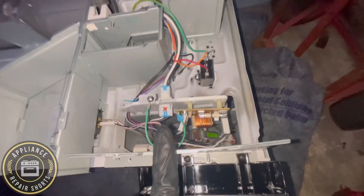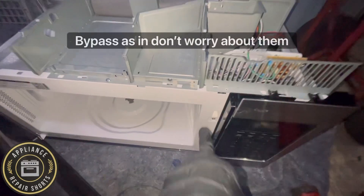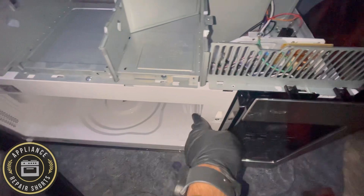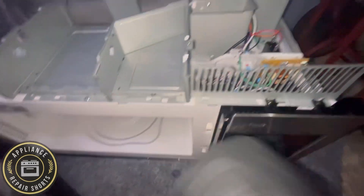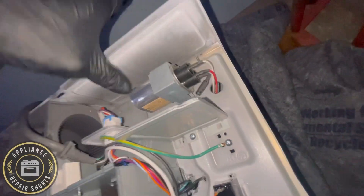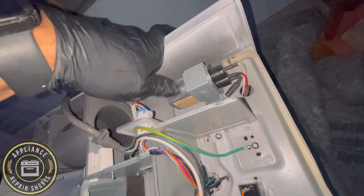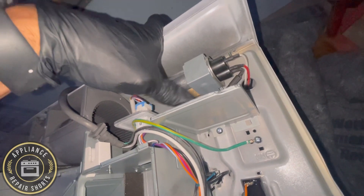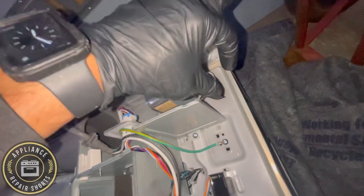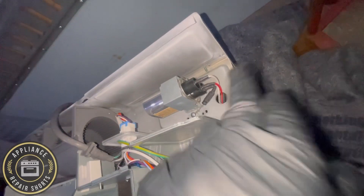We just snip this off. First things first — obviously your fuse is good. You have lights, all those things you can bypass. Your door switches are going to be good. Normally you don't have an issue with your door switches if you're not heating. So our main concern — and by the way, this is your capacitor. High voltage. Be super careful, do not handle it normally. It's discharged, but you do want to make sure you short it out if you're going to be touching or moving it. Otherwise don't touch it. It can be lethal — seriously.